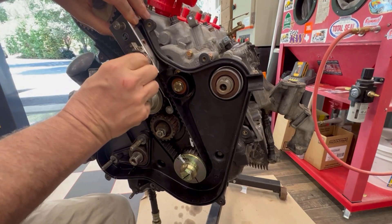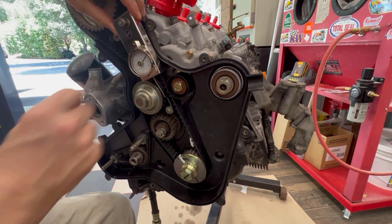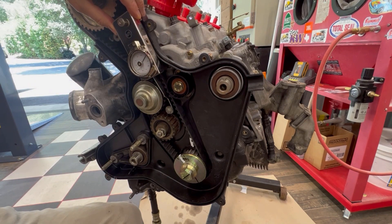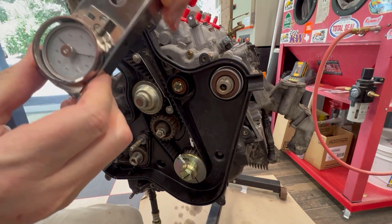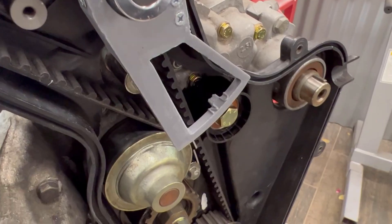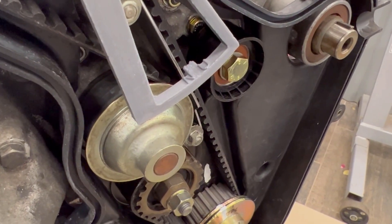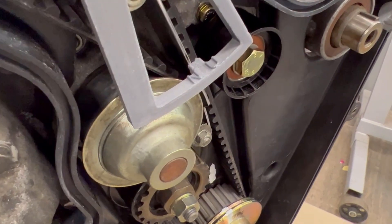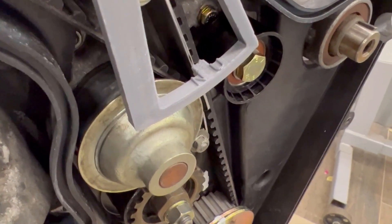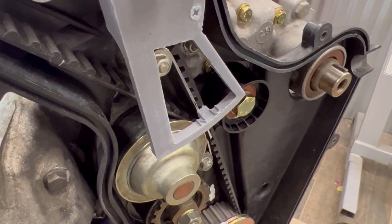Retension the belt so that it is just about on the 4 — pretty much spot on the 4. Now with the belt tensioned to 4, it should click when the pointer meets the rail at the new setting, which it pretty much does.